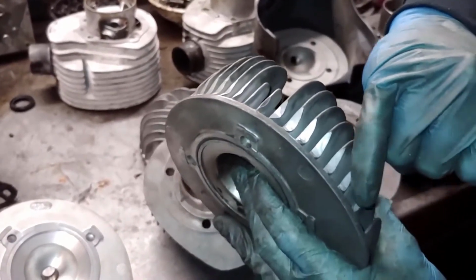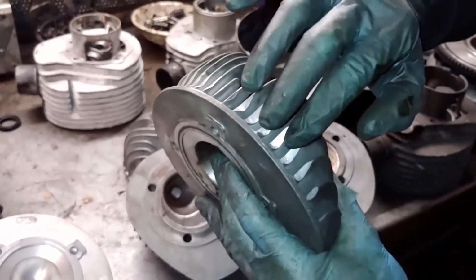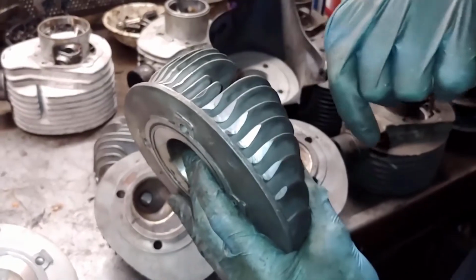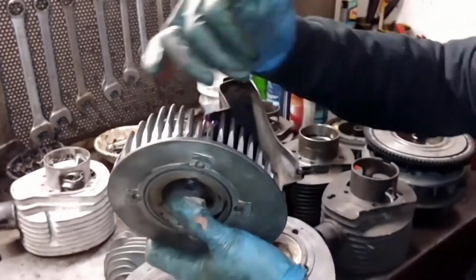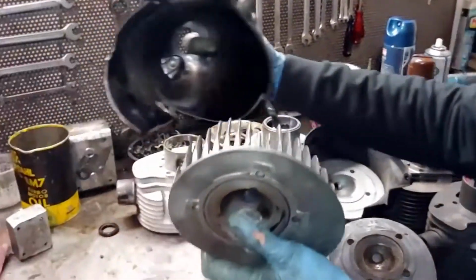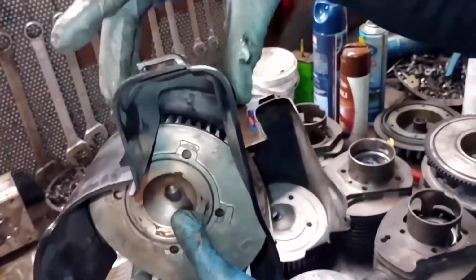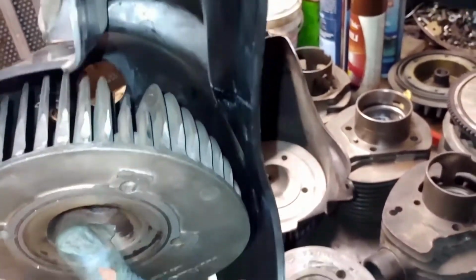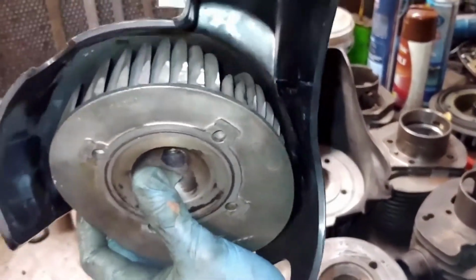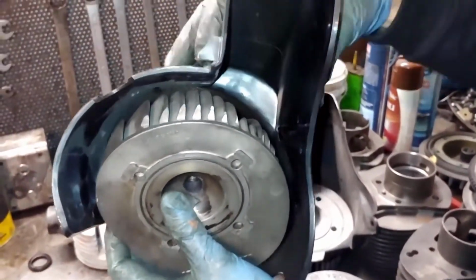Now I've done it with the flex, first with the grinding disc, and then with the abrasive cloth disc, in order to ensure that a channel is created in this area that allows the air that enters its natural path to flow also sideways and then seek vent through this part. This path. And then touch the side flaps a little better.